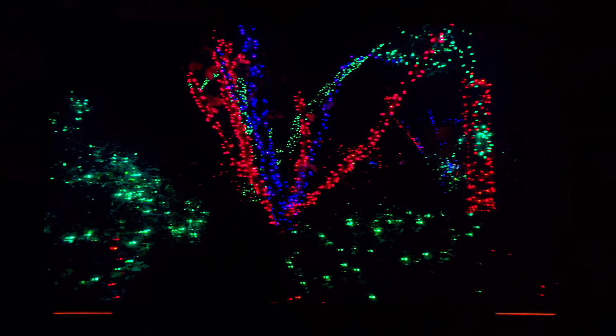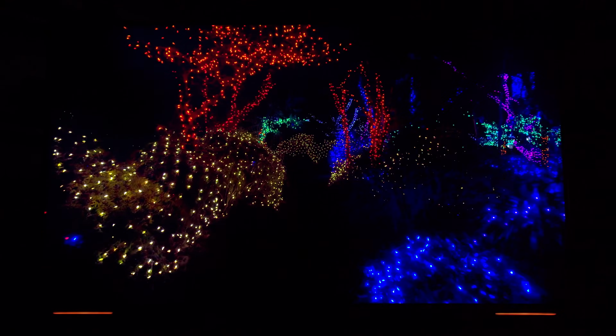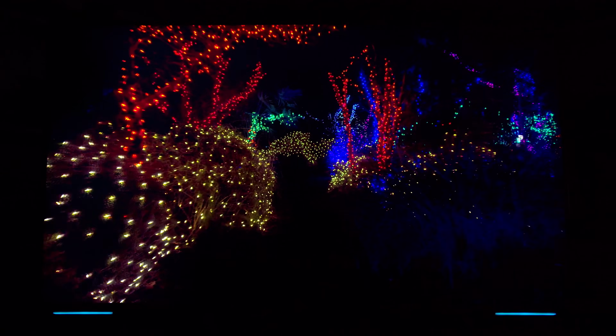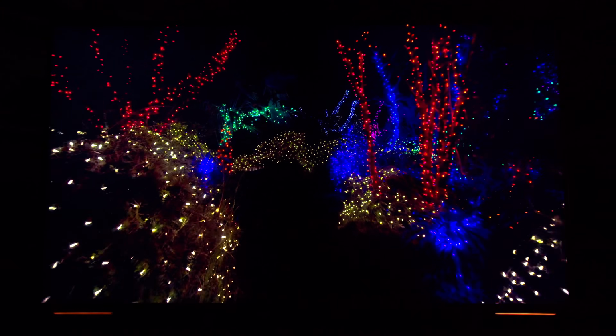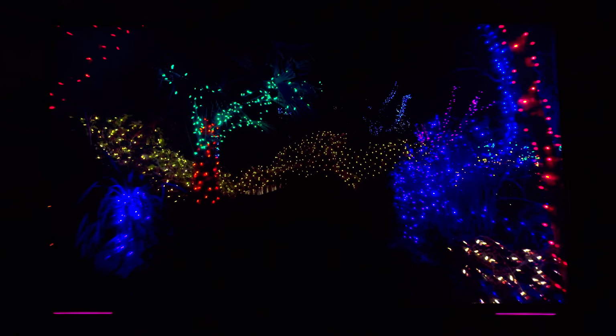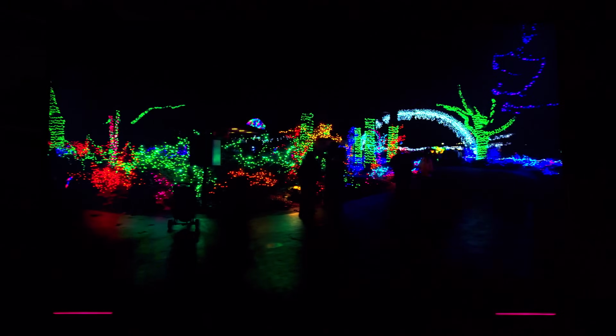Things like star fields, Christmas lights, and subtitles will show blooming around those elements simply because the zones can't dim tightly enough. There are some circumstances where we don't get blooming, but brightness is held back. On a 1196 zone FALD monitor like the 32-inch Neo G7, all of these drawbacks are improved quite a bit, though I still believe 360 zones with a high native contrast ratio VA panel is suitable for an entry to mid-level HDR experience. It's not a patch on OLED though, which has per pixel local dimming.